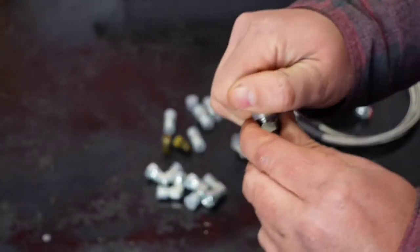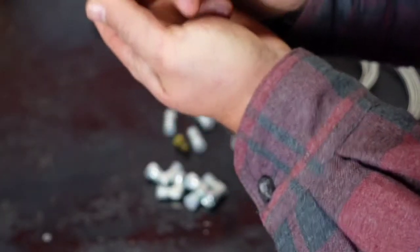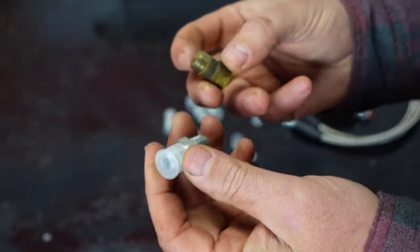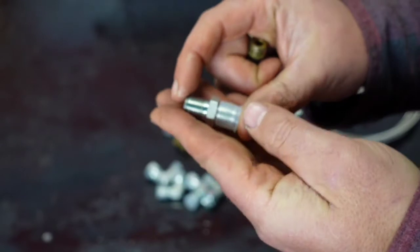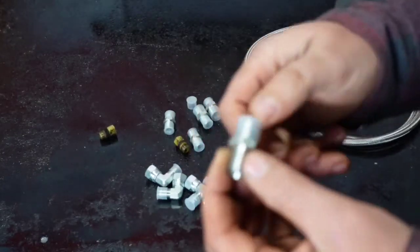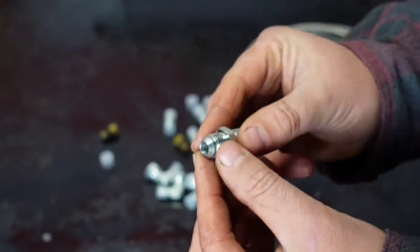The straight pieces have a compression fitting on the other end. The old fittings that came out of the transmission were a different style — and this kit is for the TH350 Turbo 350 — so the new pieces will go into the transmission itself and the line side connects here. You can see the difference: one end is smooth and the other has a taper on it.